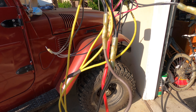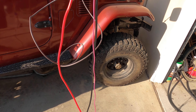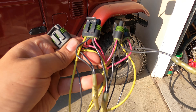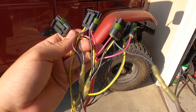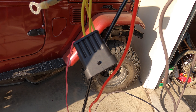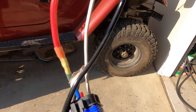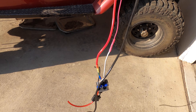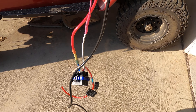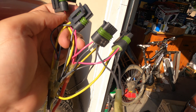I'm just about done with the wiring harness. It's a bit of a mess right now, but after I tape it up it should look pretty nice. It's essentially configured for the igniters that are integrated within the coil. I've got an automotive plug that I'm going to connect to the car, and then the rest are just power — powered by a relay and a fuse that will connect to the battery for overcurrent protection. Let's tidy this up and then plug it in.